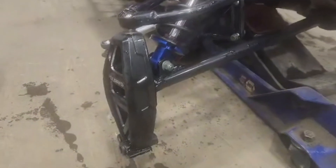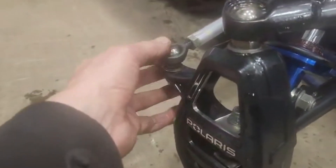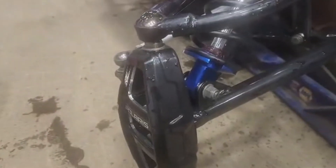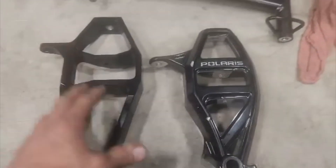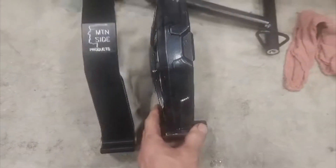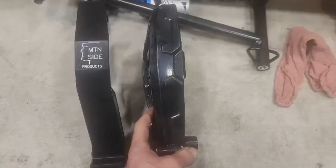One of the things we're going to do is loosen the top ball joint, bottom ball joints, and steering ball joints — take those out and I'll show you what to watch out for when putting everything back together. Besides making the machine narrower, once we get the spindles on we're going to lose probably two inches of width on the sled, which makes it easier on side hills.